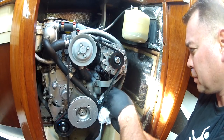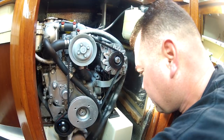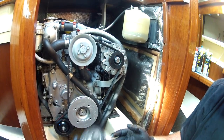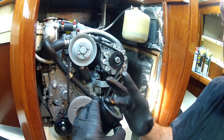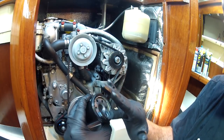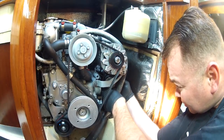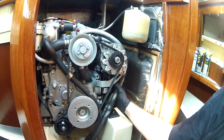I'm just cleaning up so the oil drip doesn't get down into the bilge. Put a rag down there real quick to catch it before it gets too far down. Now take the new filter, dip your finger in a little bit of the oil from the old filter, and go ahead and lube up that seal pretty good. You don't really have to goop it on there - you just want to make sure there are no dry spots. Then line it back up and make sure it doesn't cross-thread.